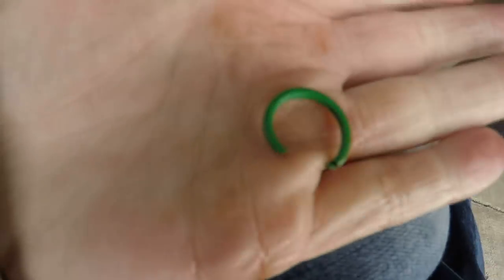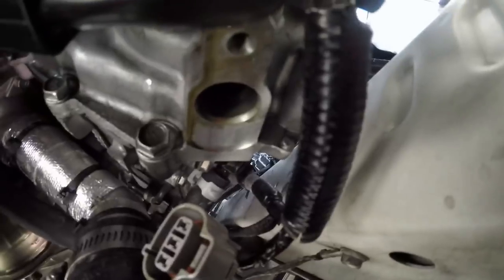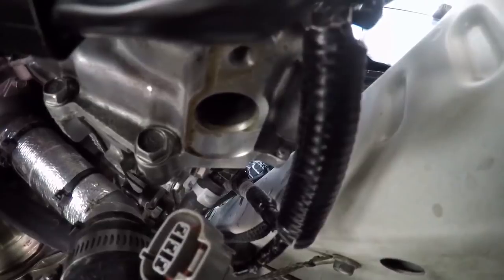It might be something I look into. I could find that milky junk everywhere in my AOS system and all that. Because I don't drive the car on long trips, I tend to get a lot of that sludge. But I am happy that I found this o-ring. The problem is explainable — that's the number one thing you always want. Even if you can't fix it right away, you want to know how this is occurring. This is a very clear simple answer: I used too thick of an o-ring, had to shove it into the hole very hard, and therefore it disrupted that o-ring upon pushing and started leaking like hell ever since. I thought I fixed it — it was actually leaking so much it was running down the J-pipe. I'm glad I saw something on the ground today and decided to take a look. That's a lot worse than just the o-ring having a little leak — I actually made it a much bigger problem when I changed that o-ring.